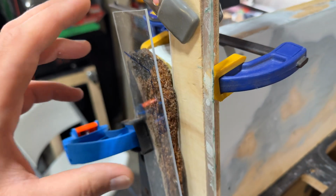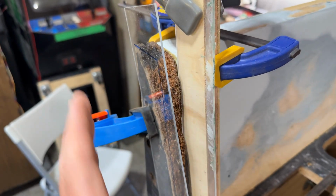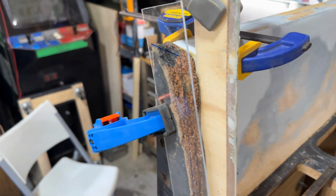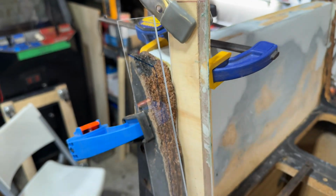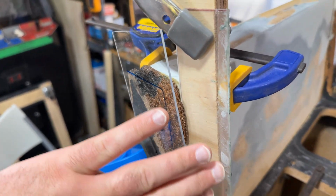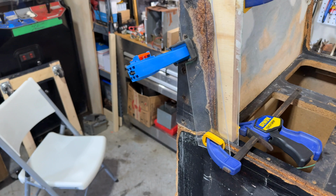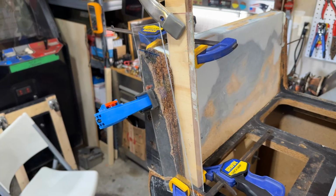We can't do it for over the top because we're rebuilding that shape, but on other sides it's just supposed to be flat. So this will make the Bondo really flat on that side. And like I said, afterwards we'll put a skim coat of Bondo to cover up the crack and the countersunk holes and all that, and really make it look good. But this form is going to be nice to hold the Bondo in place on either side and not let the Bondo move every which way. It gives nice, clean, straight lines on either side, and I can focus on building up the bulk of this toe piece. So I've got everything in place here, ready to go. Let me just go ahead and mix up some of this Bondo. I'll fill it in. We'll get it nice and shaped, and we should be good to go.